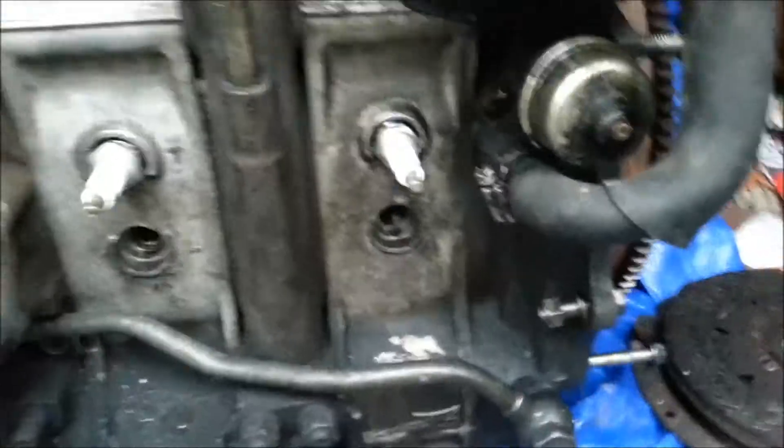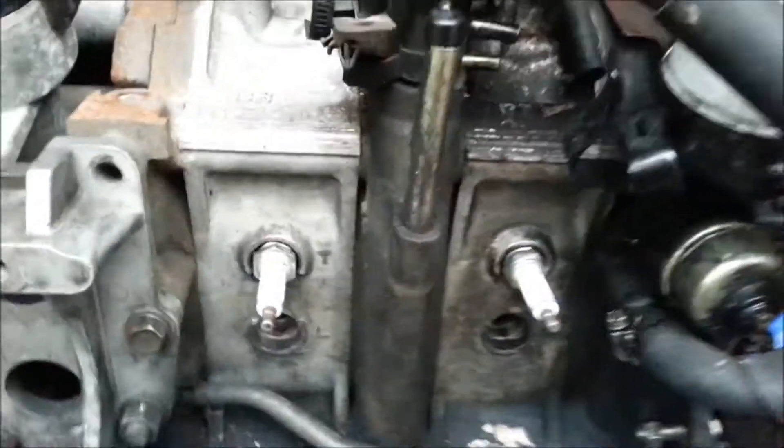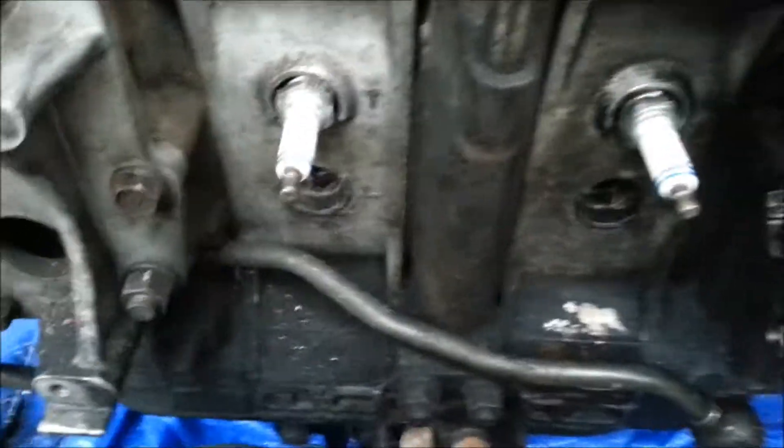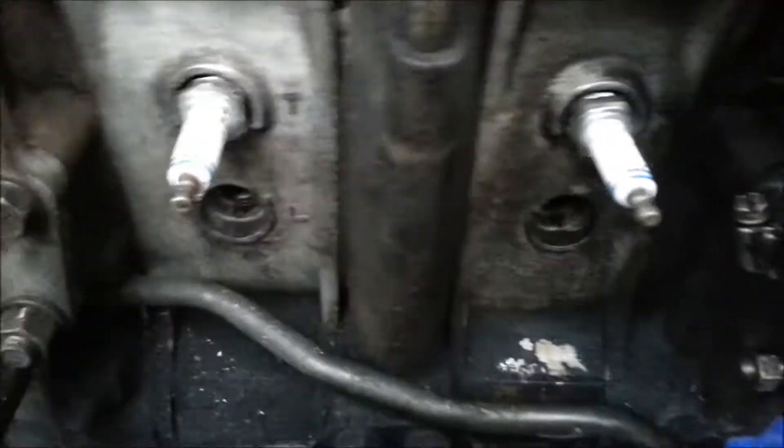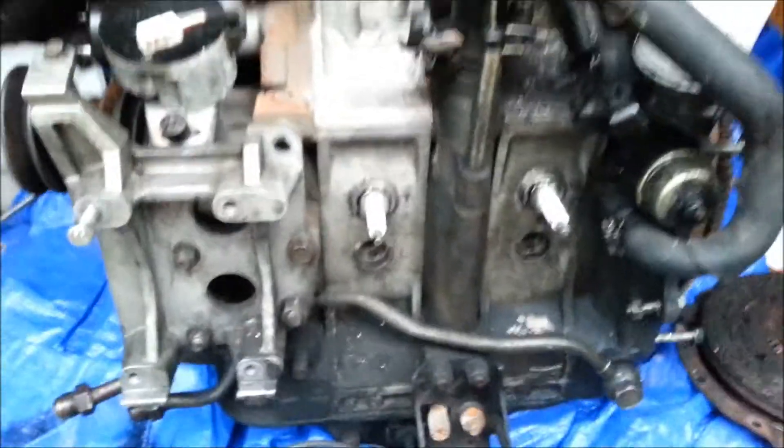After pulling off the back leading spark plug, I found out the back rotor actually has bad apex seals, which kind of sucks. I'm going to turn the flywheel so you guys can hear it — the front one goes 'poof' and the back one kind of goes flat.